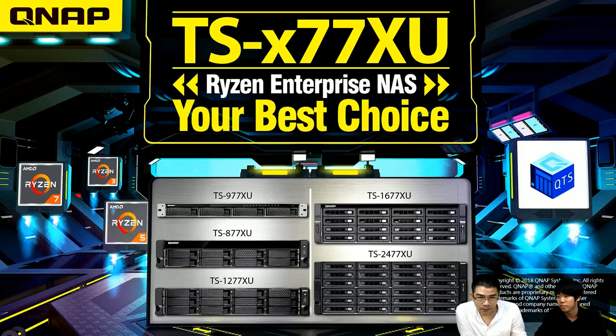And with 4.3.5, we can support SSD over-provisioning, which will enhance your read and write speed and stabilize it. Of course, with better adjustment, it can lengthen your SSD lifetime. We now provide the SSD profiling tool, so you can test your own SSD and get the best over-provisioning percentage by yourself. And the newer QTS provides Snapshot Vault, and now you can do remote site recovery with all your snapshots to lower your RTO.